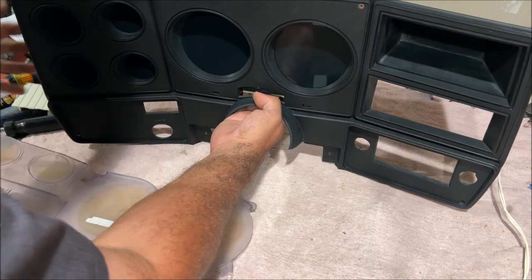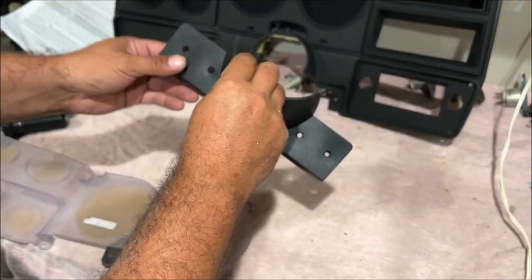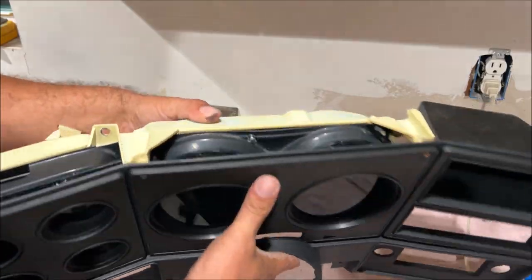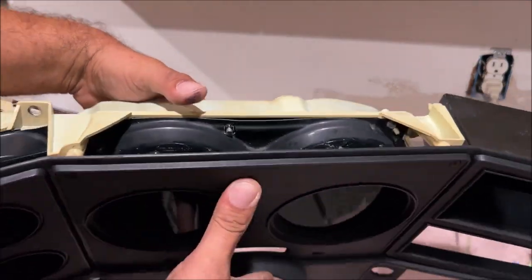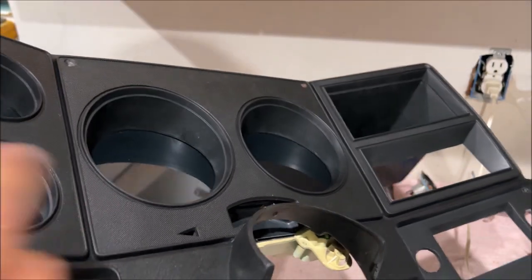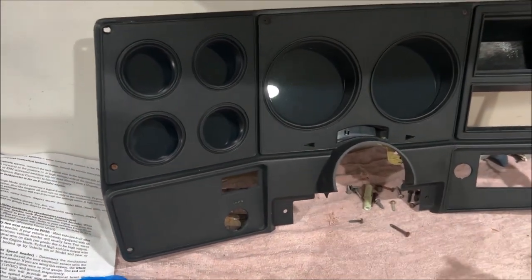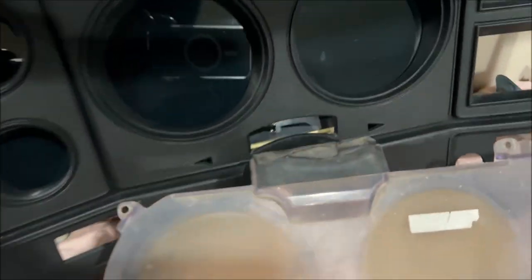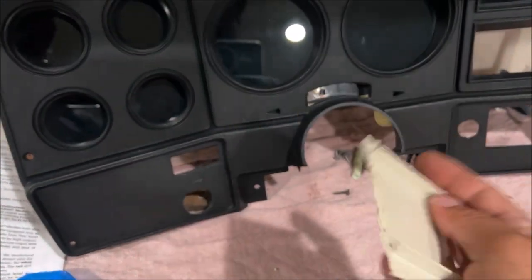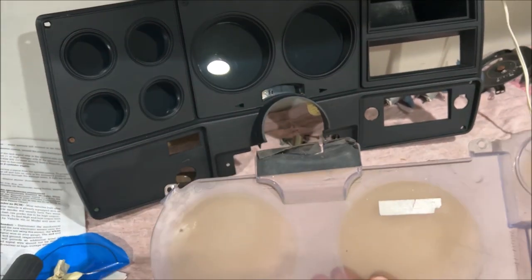All right, so I'm gonna be hunting down all the correct screws for the installation video. I went ahead and painted this little piece down here too. Very nice. This cluster is tightened down to that bezel. It's screwed in like it's gonna go in on the truck. And we barely had enough room for those lenses. So we did not use our factory lens. And remember, if you do, you're gonna have issues with your gear selector. I'm gonna get a little piece of plastic, paint it, hot glue it back there, and you'll never notice it because the factory just put a piece of electrical tape.